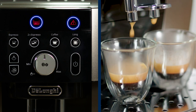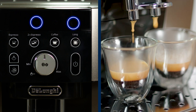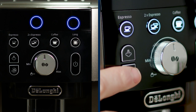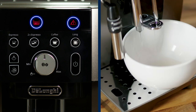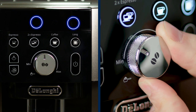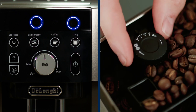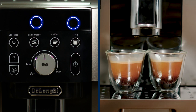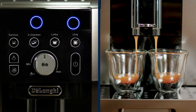Warning lights: Ground container and warning light flashing — this usually means the coffee is being delivered too slowly or not at all. It may be that the grind setting is too fine. First, use the manual rinse function to clear the circuit and reduce the aroma strength for the next coffee. Then adjust the grinder to a slightly more coarse setting and make two or three more coffees; the flow of espresso should improve.